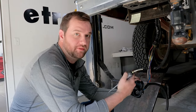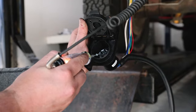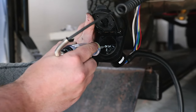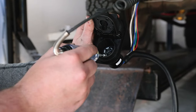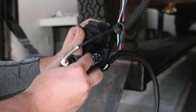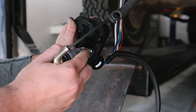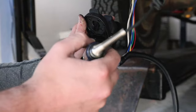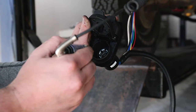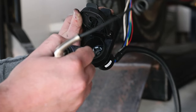Before we wrap everything up, we're going to test all of our wiring. We start with our left turn signal, then the right turn signal, then the running lights, then the brake signal. When you hear that noise it's just because there's low power being sent to the brake controller itself. We also test our 12-volt power, which will be hot all the time as soon as you turn the key ignition on, and then our reverse lights. While doing all of this we have somebody in the driver's seat changing all the functions. Our ground is working because otherwise none of the other functions would work.